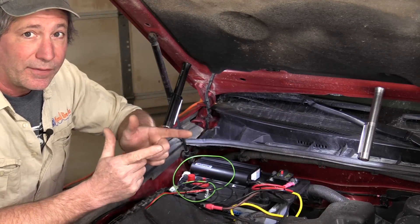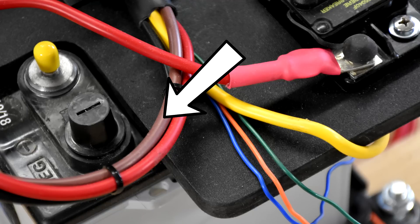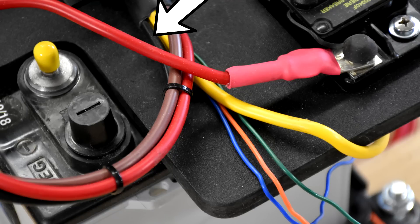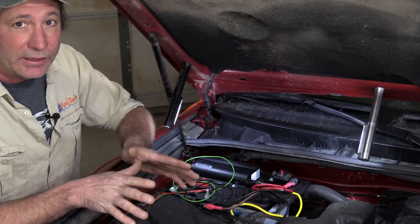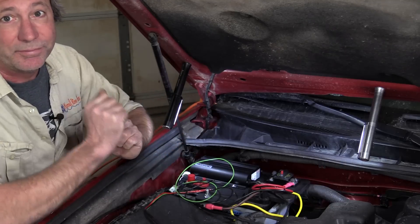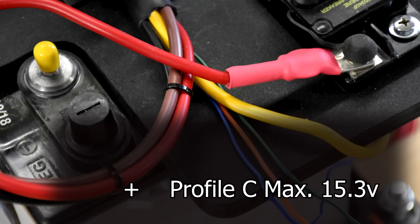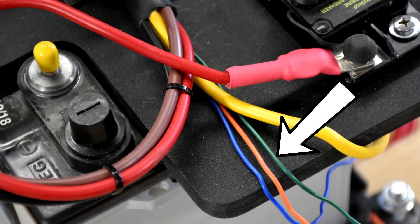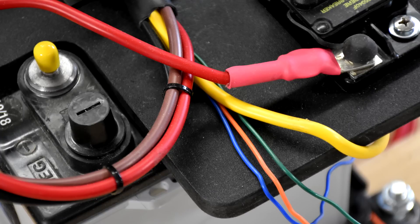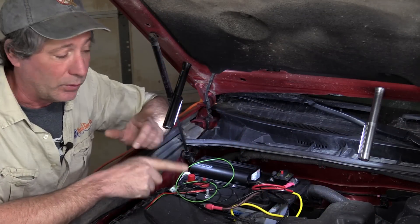Here is how the wires coming out of the charger get hooked up: the red wire connects to the starter battery through the circuit breaker; brown connects to the second battery positive; black connects to the second battery ground post; yellow is for our future solar panel, dead-ended for now — there's no need for any additional solar controller, it's all handled inside the RedArc charger. The orange wire tells the controller what type of battery it's charging — for our AGM it stays unattached, just dead-ended. Green is for an optional dash-mounted LED that comes on when the second battery is charging. The blue wire will go through the firewall to the fuse box under the dash, where it ties into an ignition-on circuit to tell the charger when the engine is turned off so it can completely separate the two batteries.